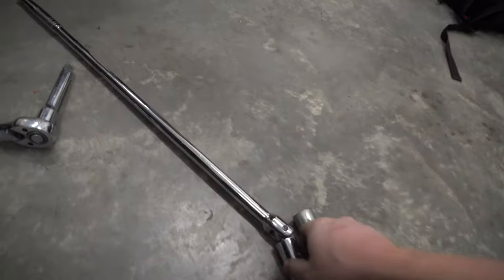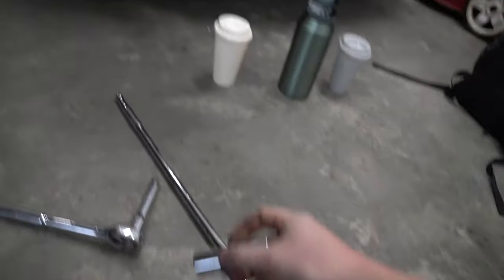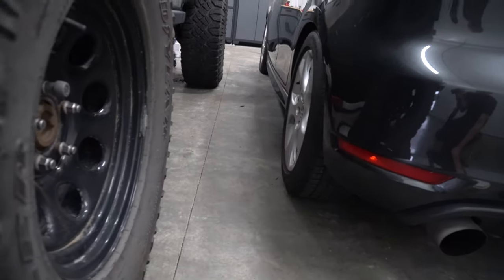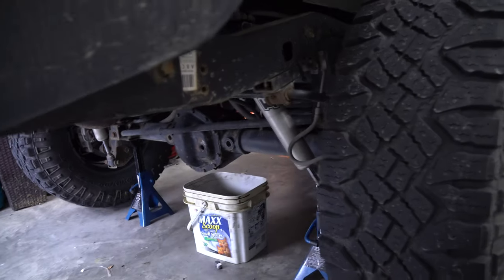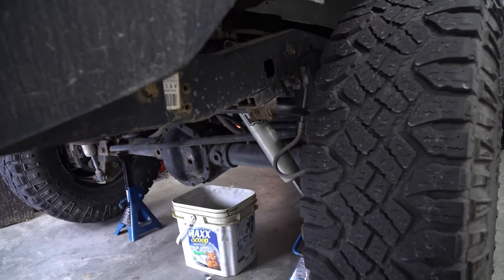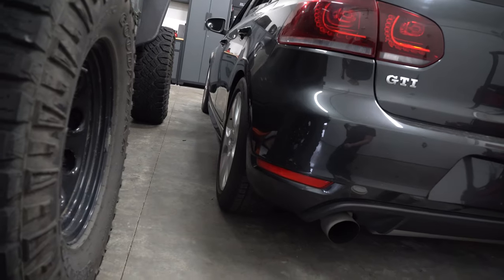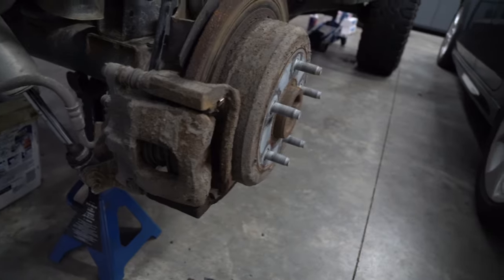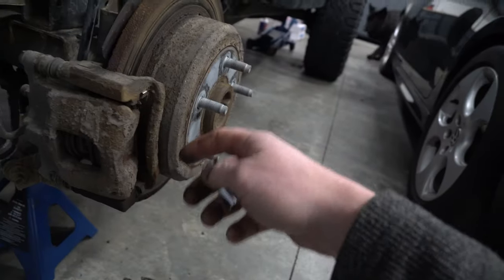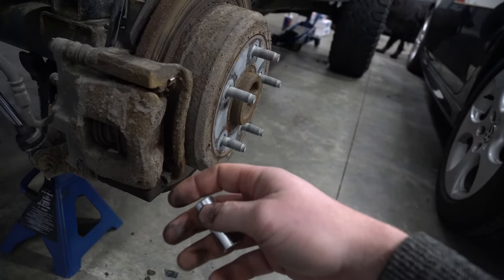I'm also going to be doing a tire swap as I do this. Next thing you're going to do — put the 19mm on another ratchet and go ahead and loosen those bolts off on both sides and get both tires clean and off. You could leave one on for now if you really wanted to and just do one at a time, that way you don't mix your tires up. Once you've rolled that tire out of the way you can use it as a seat.